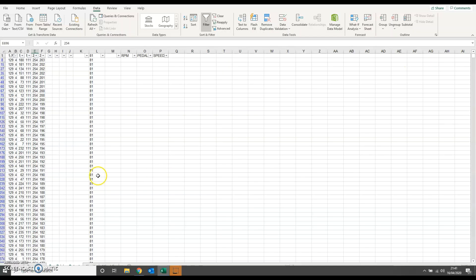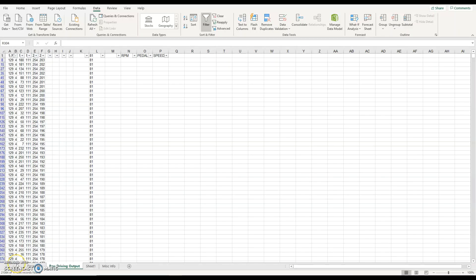Make a list of things you're actually looking for - temperatures, speeds, revs, throttle pedal positions - because there's lots of information you're not going to want, so there's no point trying to work out what it is. Don't be afraid to connect to the CAN bus and look at the codes live. You can place a filter in the code so instead of displaying all the codes, just get it to display code 81 for instance - the steering wheel angle. Sit in the car, steer left and right, and you should see the values change live. That works for everything from throttle pedals to indicators to aero lights.